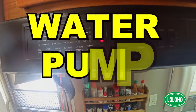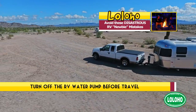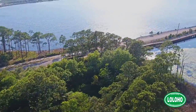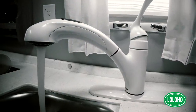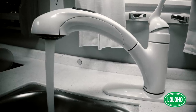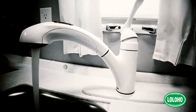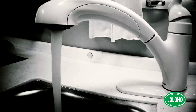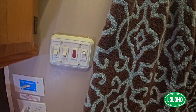Your water pump needs to be off anytime you are traveling in the RV. Some people say you should even turn the city water off when you leave your campsite. Things can happen when you're outside the RV, especially traveling down the highway. If you leave the water pump on, it's pretty easy for a faucet to get jostled open and water will start pouring out. We have friends this happened to on a trip to Alaska — they mistakenly left their water pump on, hit a dusty bumpy road, and their kitchen faucet suddenly kicked on, filled up the sink, spilled all over the floor of their Airstream, and just about wrecked their trip.